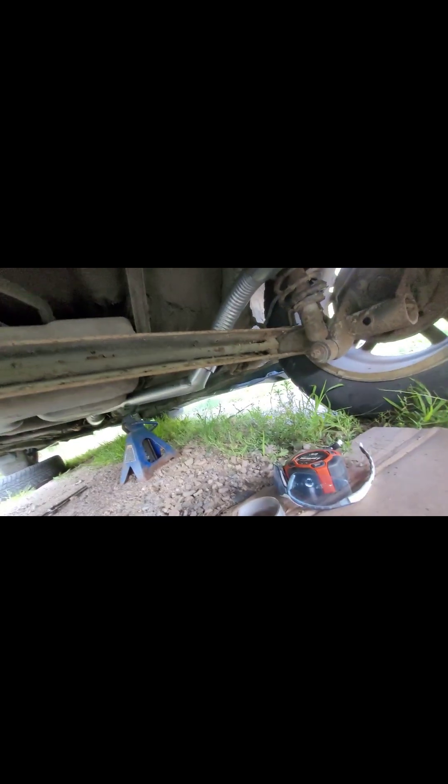Hoping with my leftover pipe I'll be able to finish the bends I need — on to the last step. Now we're starting to get somewhere. Built it in a couple sections — that looks pretty good from the back. I'm gonna weld that, close those gaps, and there's where the clamping point's gonna be. Pretty close — I like it better than flanges down there, that's a stupid design. I'm gonna throw a nice little hanger there, wrap around to our nice Flowmaster — sounds pretty good on this old girl, not too loud.